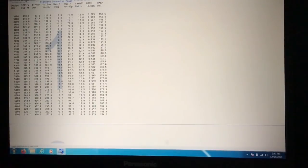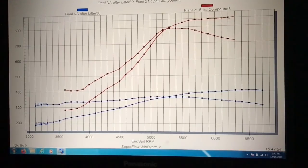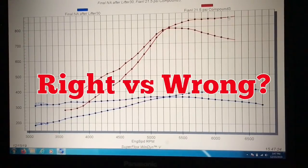The big question is how much power did it make. The NA motor was at about 409 horsepower, and at the highest boost level — 21 and a half pounds — she was up near 849 horsepower. In today's LS world we've made 1540 with a stock bottom end 6-liter, so it may not seem like much, but it worked out well. I got to learn a lot about compound turbo systems, the importance of properly matching the turbos, and how to play with wastegates, springs, and controllers. Make sure to like and share, ring the bell, and leave some comments telling me what else you want to see and what I did right and wrong. See you in the next video.